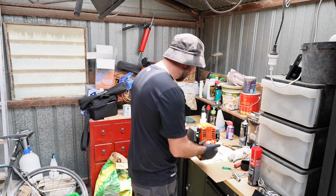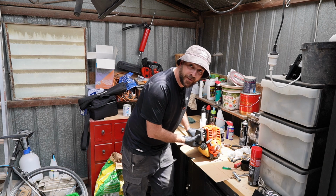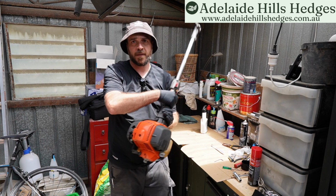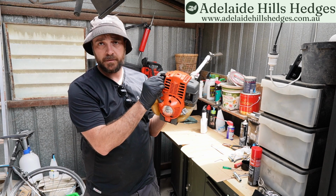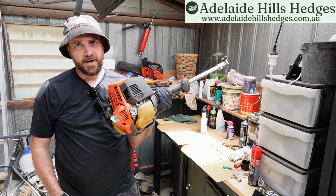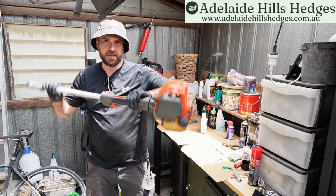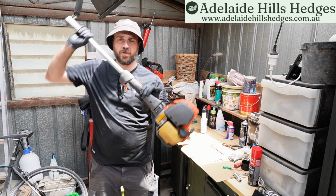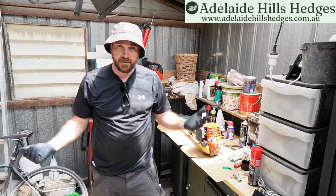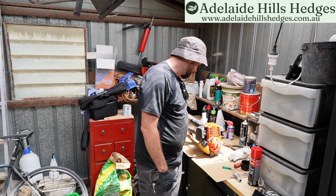Now I'll start this up for you, and I'm just going to leave it at an idle. I don't want to be revving the engine in here because there's just no need to at this point. I did all that this morning. There she is, purring like a kitten with a choke. No smoke coming out of there. And yeah, I always like to give it a little rotational test to hear if you notice any differences in the engine. But anyhow, that sounds pretty good to my ear. I'm not even getting a heavy smell off of that, which, considering how much smoke the thing blew when I first fired it up, is miraculous.